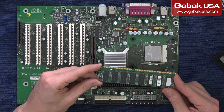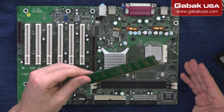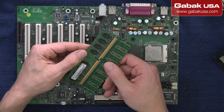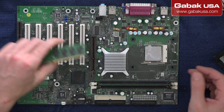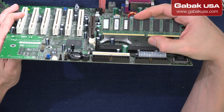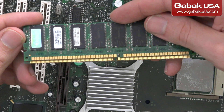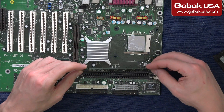This is the RAM. When you buy RAM you're going to have these sticks, as you can see here, and they are going to fit if you get the right RAM - otherwise it will not work. Here I have different RAM: one is DDR2 and the other one I think is DDR1. If you put it like that, you're going to see that one fits just fine. We have a little notch here in the middle. The notch in the other RAM is a little bit different, so as you can see, they don't fit - they are just a few millimeters apart. That is why you have to be 100% sure of what kind of RAM you are going to use.